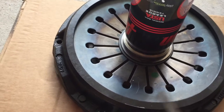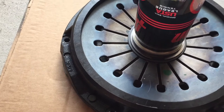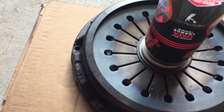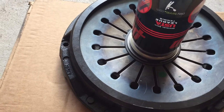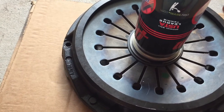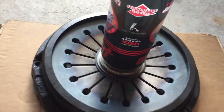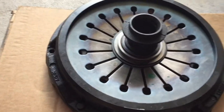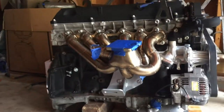and flexed on you. So I pressed it down with the tennis ball container and opened it at the same time with the snap ring expander tool, so that it stayed kind of flat while I was making it wider, and finally it snapped on there. So that is how I did it. Thought that was extremely difficult, but now we can install this onto the engine. Let's do it.